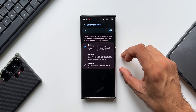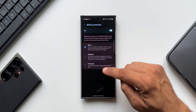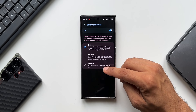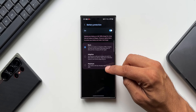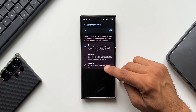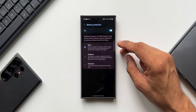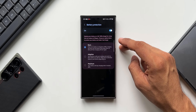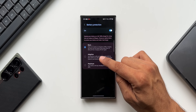So which one should you select? For maximum battery protection you can choose Maximum, but there's a trade-off: you only get 80 percent battery. If you're a power user or moderate user you may have to charge the phone early in the evening, which isn't ideal. Maximum is best for light users who can manage an entire day on 80 percent. If you're a heavy user, Basic is the option — you'll get 95 to 100 percent, enough to last a full day or more.